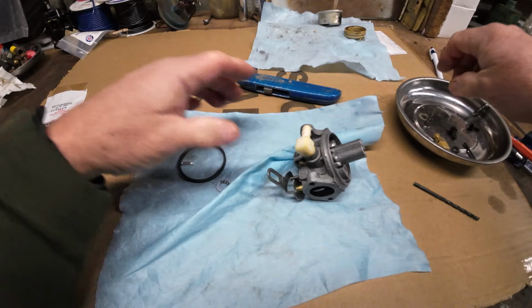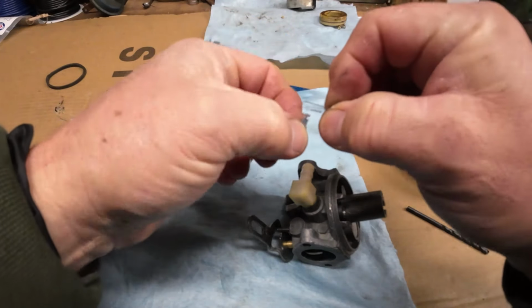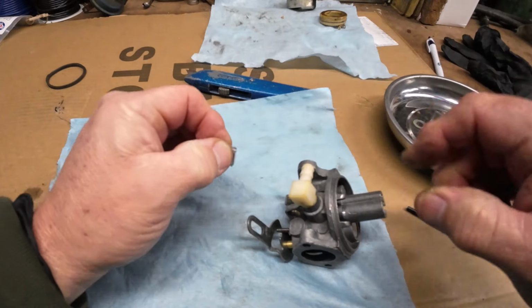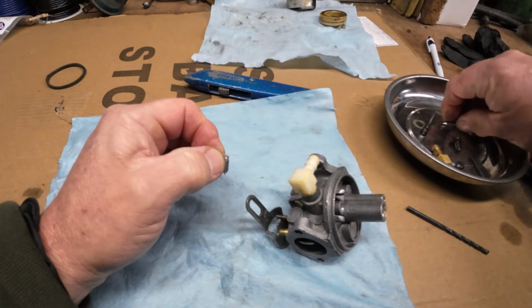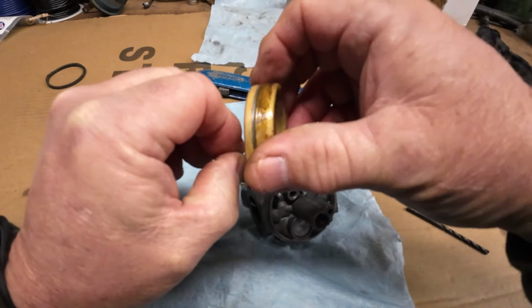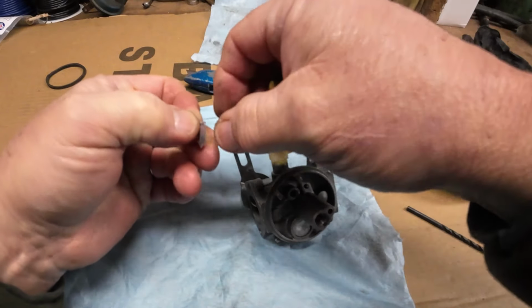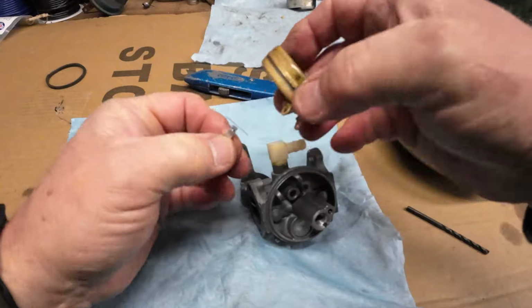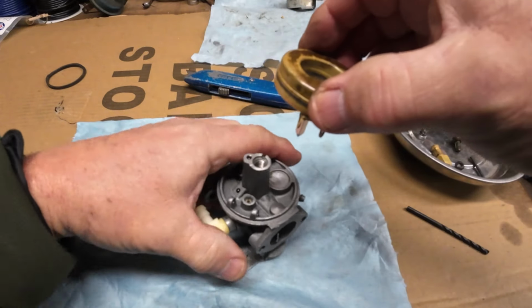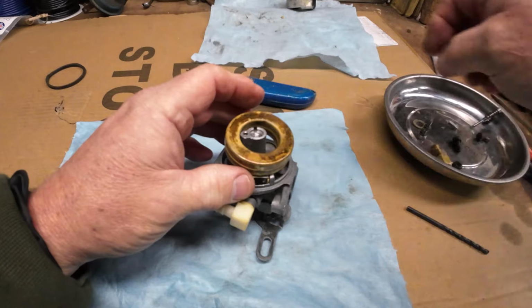Next thing, we got a new needle, and we just slide her on. Middle little clip, slide her in. Some of these, the older, the way they are now, you just have a piece there. You don't even have that metal clip on it. Grab her float. Come on now. It's my first time, I guess. And ease her on down in there. My pin.